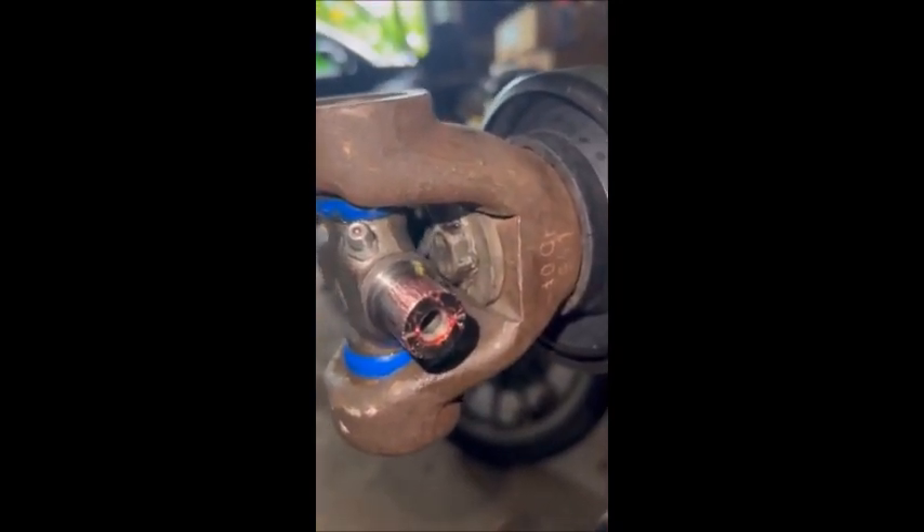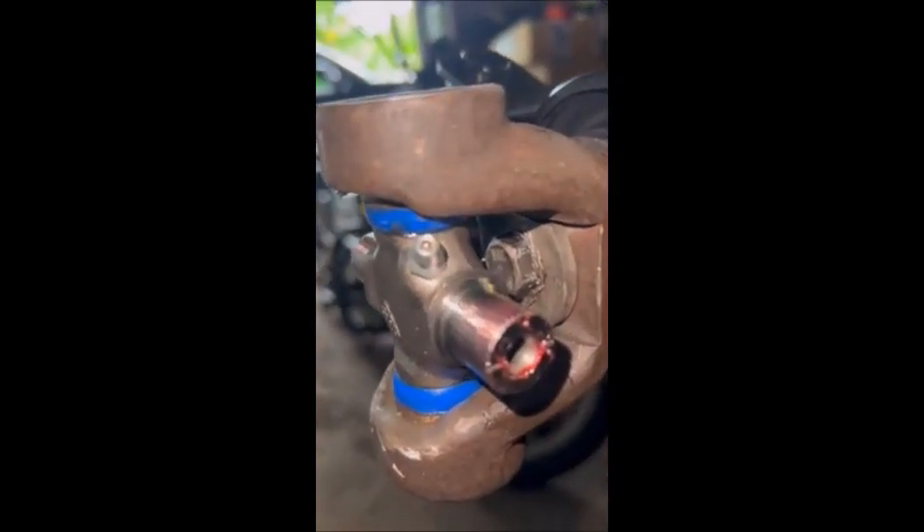That's 17 millimeter — I don't know the exact torque spec but I tightened it up and folded the spring flange back over to lock it. Everything's in there. One more thing to point out: all these u-joints have zerk fittings, but once everything is together there's no way to get a grease gun on them. So I've been packing them with wheel bearing grease by hand before putting them on, so they're well greased instead of just the factory stuff. Load them up, pack grease down the center hole — just sharing what I've run into.